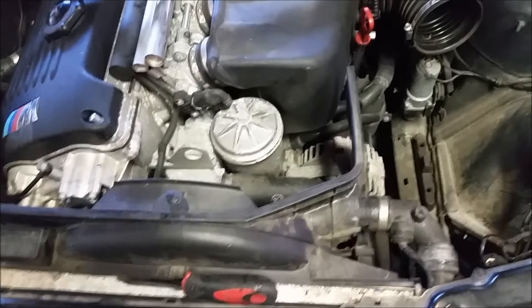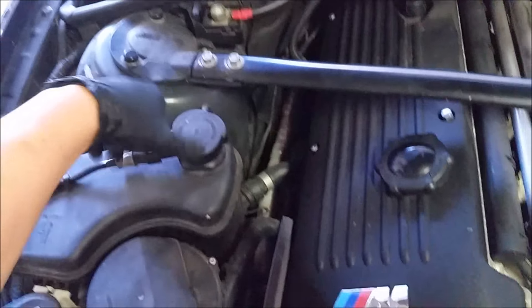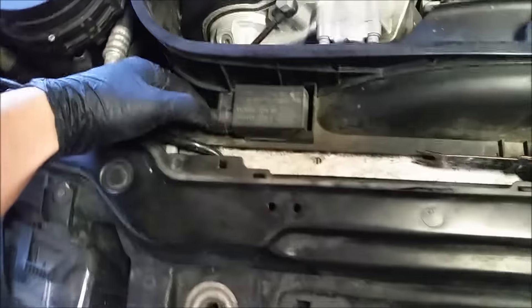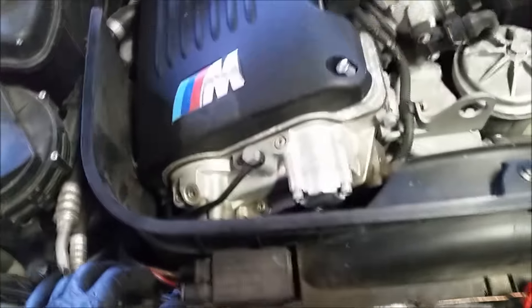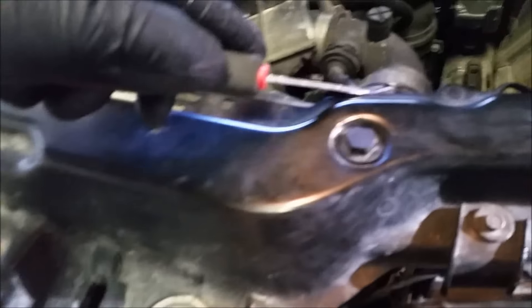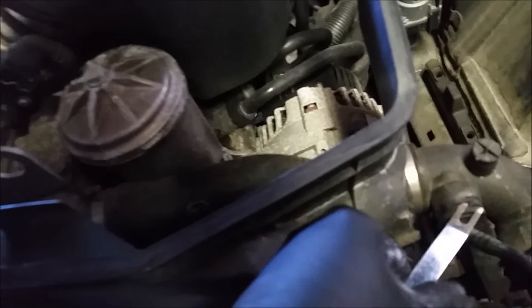Make sure your engine is cool before you work on the radiator. We're going to pop up this clip, pop up this clip, remove this plastic clip, pop off this sensor, and then try to get to the fan. Put a bucket underneath the car just in case to catch some of the fluid. Then we're going to use a mini screwdriver to wiggle off this hose and take off the shrouding.